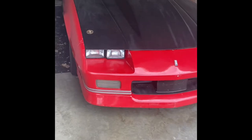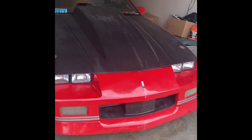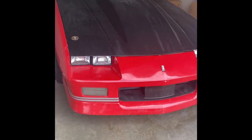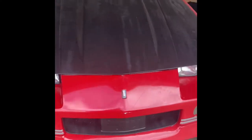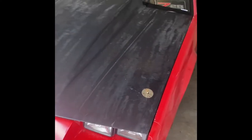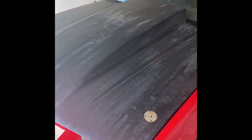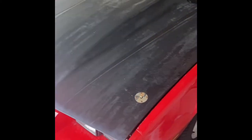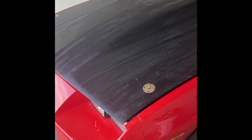I've got to move a car from in front of the garage and get the race car out. I want to heat the garage up so the oil is slightly above freezing before I start the car — this thing runs race oil so it's really thick. I want the oil to get to the heads and parts of the engine, which takes a while on a cold start.